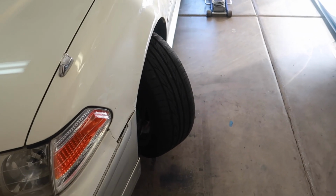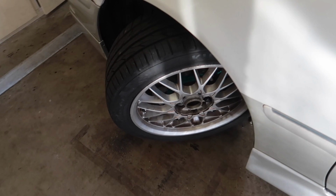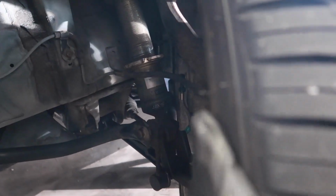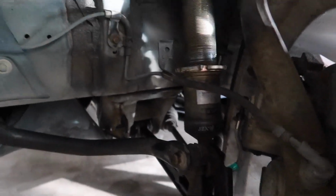Now here is leading left at full lock. Again, no obstructions, nothing is binding, all the brake lines and ABS lines are good. Just the tire rubbing on the X100 tension rod, which again, to combat that, a 10-15 mil spacer. Huge shout out to 09 for such great quality parts. And another bonus is my coilover is right here with easy adjustments. God bless, that is really beneficial.